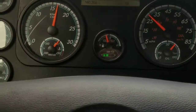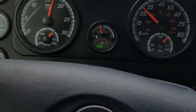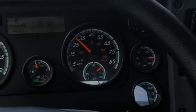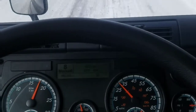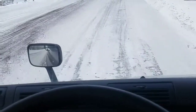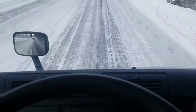If we were wheel spinning we'd have to downshift again and run a little lower RPM, and again no chains. These conditions aren't that bad — it's about a couple inches of compacted snow, not even that at this point, with a little layer of ice under it.